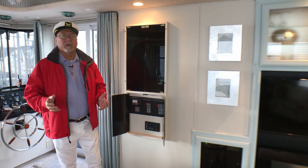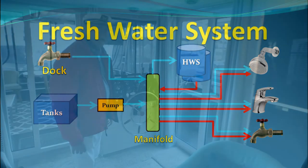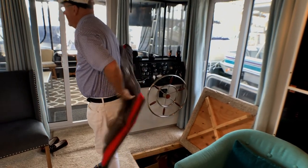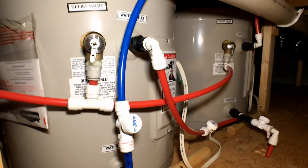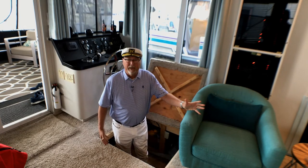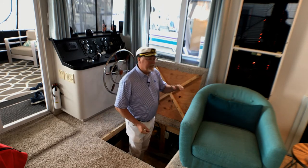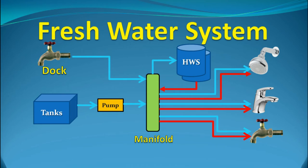There's not much use in a plumbing system if all it has is cold water, so our boat does have a hot water supply system. This system uses two 20-gallon tanks plumbed in series to give a total of 40 gallons. They're constructed this way because of the height limitations below deck — just over two feet. This can be an issue when replacing hot water tanks on older boats, as new tanks made to changed EPA regulations require more insulation and are therefore taller for the same capacity. If you need to replace your hot water tanks, you can find smaller capacity tanks that will fit in the same area.